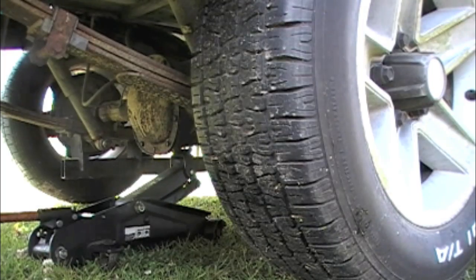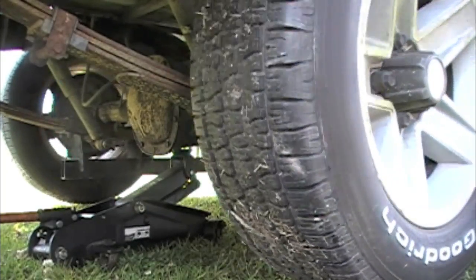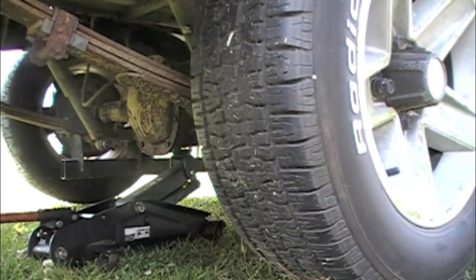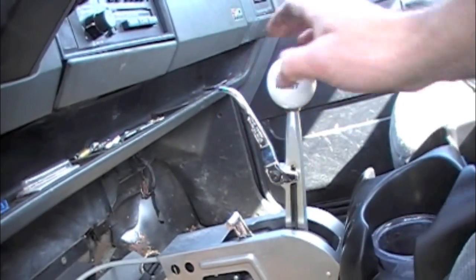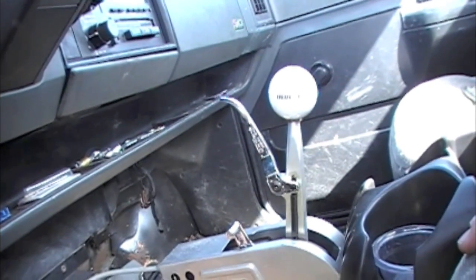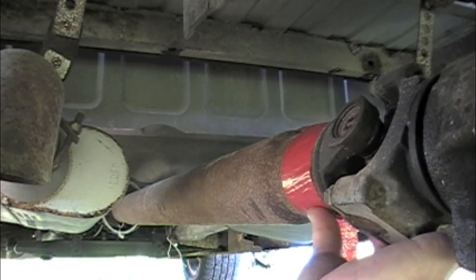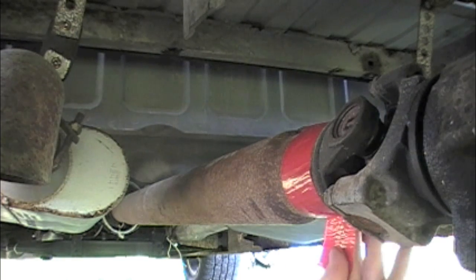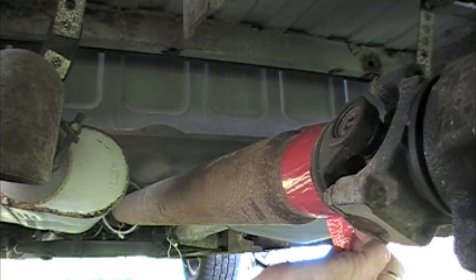You're welcome. Step one: I've jacked up the rear end right under the pumpkin. I've got both tires up off the ground — this is my one-legged rear end. Take the truck out of park, make sure it's in neutral. Step two: put a tag, flag, or tape so you can count the turns.